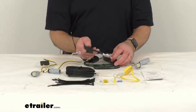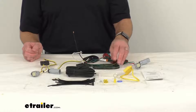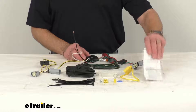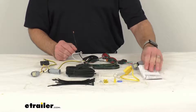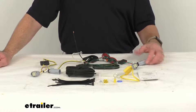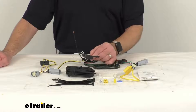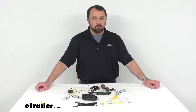The maximum amperage for the stop-turn lights is 5 amps per circuit, and for the taillights, 7.5 amps per circuit. This is constructed of 16-gauge bonded wire, and detailed instructions with pictures are included. It is also recommended that you use a small amount of dielectric grease on your electrical connections, like the plugs on the vehicle or the four-pole connector itself, to help prevent electrical failures caused by corrosion and moisture. You can find that on our website using item number 11755.